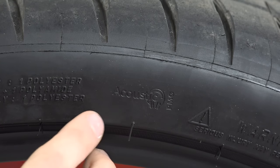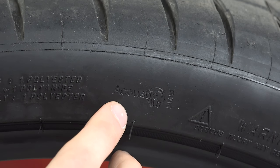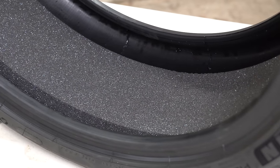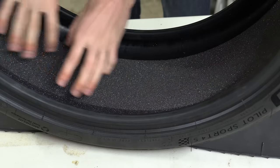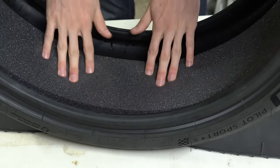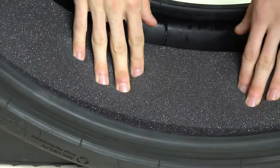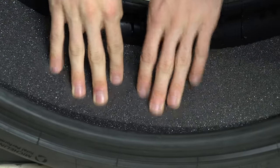You may have noticed the foam inside this tire — that's what this acoustic label is referring to. A rolling tire causes regions of air pressure to vary within the tire itself, and those varying air pressure regions create vibration that is audible and transmits to the car. By placing foam within the tire you help reduce that vibration and noise, with the primary benefit being a quieter ride.